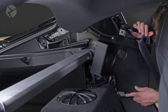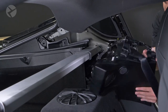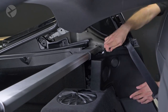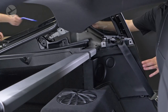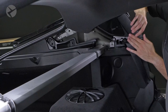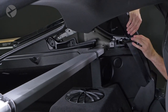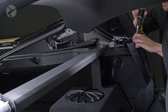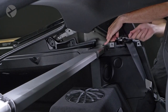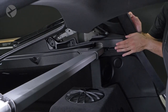To put the rest of the trim back in place, start by taking the lower piece and sliding it up and then down into place — it will take some articulating if you have the crossbar. Before you screw it down, snap the B pillar trim into place and then screw down the lower trim. Snap in these last two pieces and you are finally done.